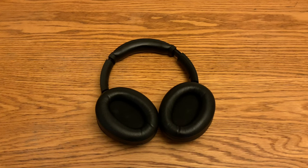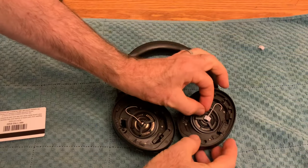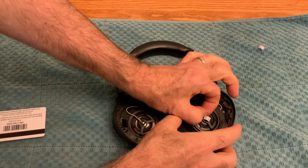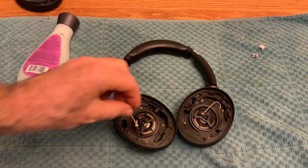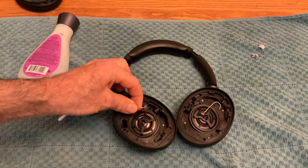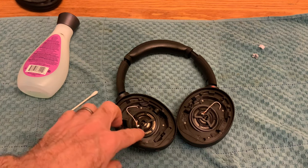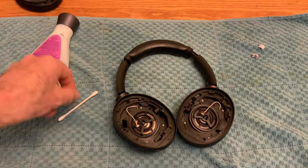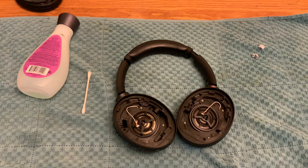What I'm going to do now is take off those little microphone covers completely and just go without any cover on the microphone and see what happens. These little white rubber covers — you just grab them by the corner and they come off quite nicely. There's a fair bit of glue on the microphone, so I'm going to take some nail polish remover on a Q-tip and try to get that glue off as best as possible.